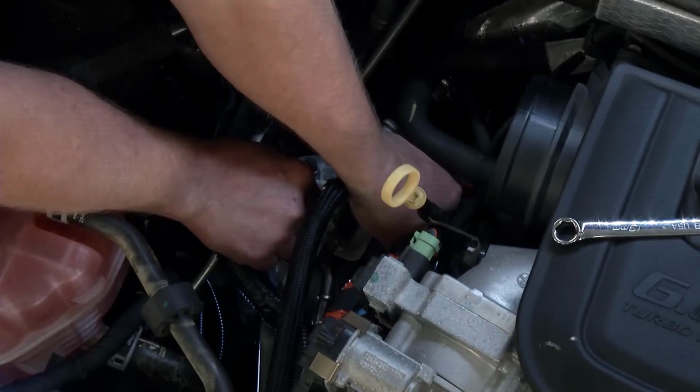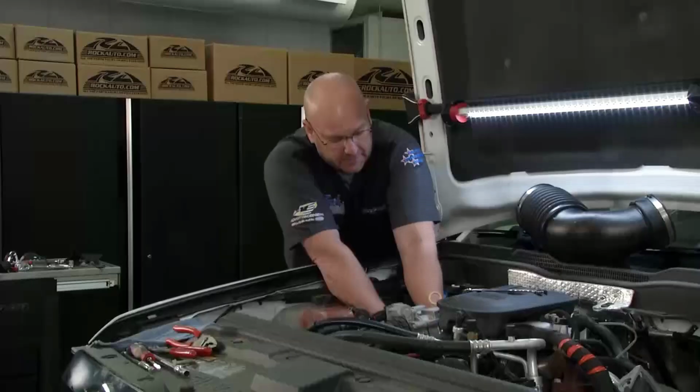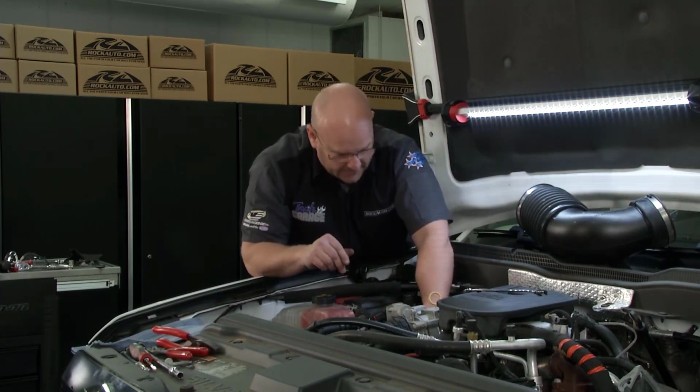Okay, last mounting bolt is out up on the top of this bracket. That means the whole assembly is ready to slip down out. Let me get this bolt out. Now, you probably saw we have a drain pan underneath. Sure enough, when I disconnected that second fuel line, we got a little bit of drippage. You want to catch that, take care of it.